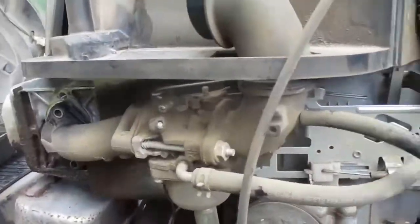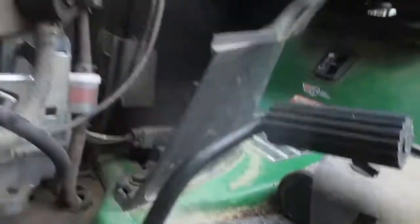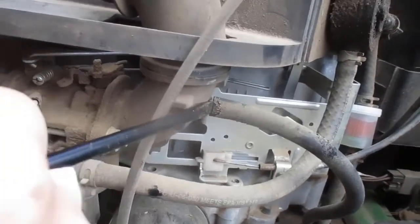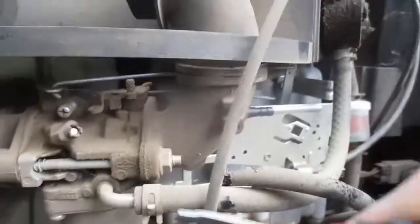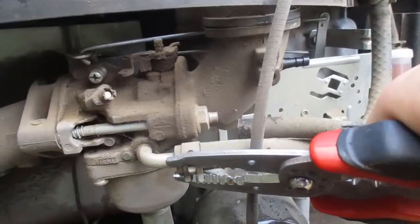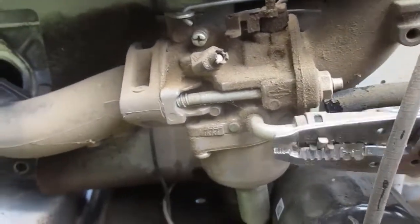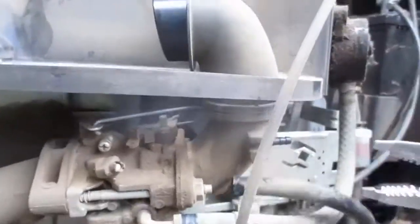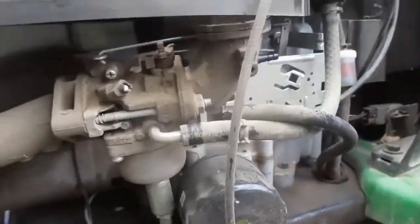Let me make sure I set the hood. I don't want any water getting into this. You might notice you have to take off the air filter first, because it's disintegrating a little. This is the fuel line hose from the gas tank. This is just a fairly ordinary float carburetor. I'm using some wire-type hose clamp pliers, but you can just use regular pliers or needle nose pliers — either of those will do the same.